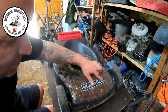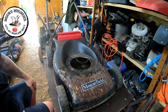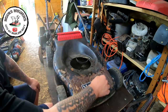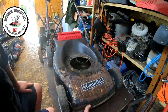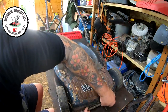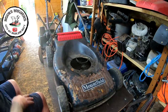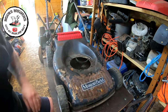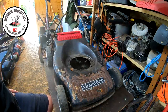In fairness, if I can keep this Mountfield sticker as is, mask up that, give it a bit of a blow-off and a dry-off, we'll be good to just start painting. Take the wheels off where necessary and paint it up. That sticker there - I'll take it off in one go, give it a clean-up and it could be re-stuck. Put that to one side and we'll keep the originality of it. A little bit of sanding with the old drill wire brush just to clean it up and we should start painting.